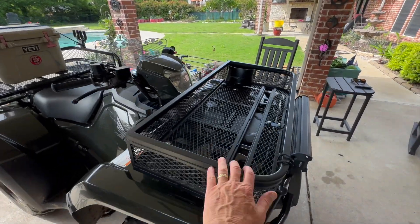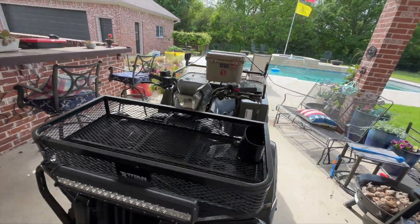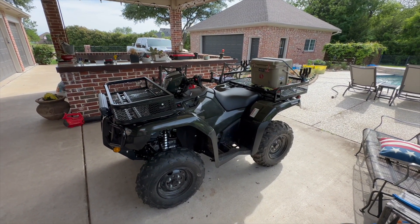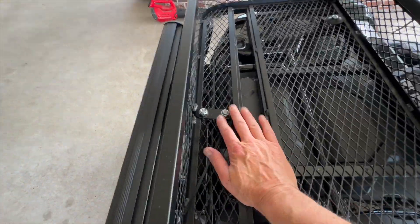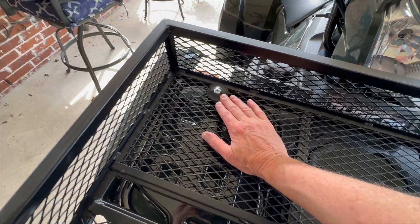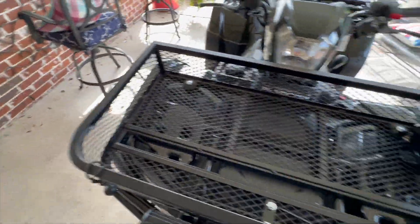The next upgrade we did — we put Titan racks on the front and back. I got this idea from Stony Ridge Farmer. He put them on his Honda four-wheelers and they are very versatile. They're generic racks and you can mount them pretty much any way you want to any type of rack system. We used a couple of the U-bolts that were supplied. I did paint the brackets black so they match in. Up here, instead of using the factory-supplied hardware, I used some fender washers and nuts and bolts — I wanted something a little lower profile.